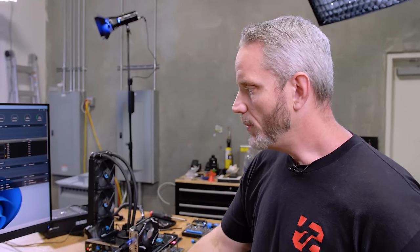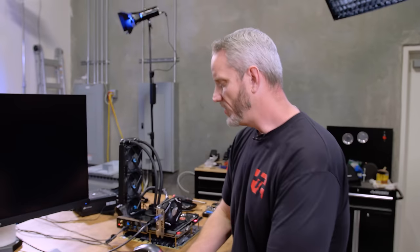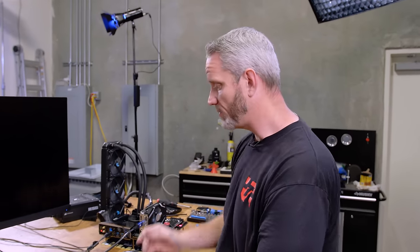Okay, fine. So I'm going to go back into the ASRock BIOS, and I'm going to now enable the offset of the voltage. The thing is, I would love to enable the offset myself, but I don't know which voltage it is. There's tons of voltage options in this particular motherboard. And the ones that I've changed, which all talk about CPU input voltage and CPU core voltage, had no effect. I was bringing them down to like 1.275 and then going in and running the test and seeing 1.35. So I wasn't seeing any change with any of the voltages that were listed as CPU voltage.